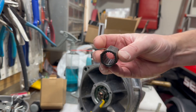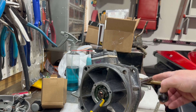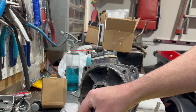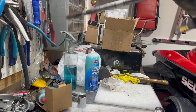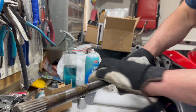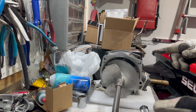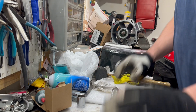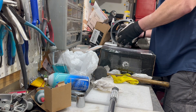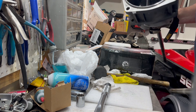At the beginning I said I was using an impact because I didn't have the right tool yet. This is the spline nut that goes over the ends of the splines on the drive shaft. When I tighten this nut, I'm going to hold back using this tool. We're going to torque this to 53 foot-pounds — that's in the manual. I'll use my vice since it's a little awkward otherwise. There's drive one done. Now I'll move over to drive two; this one's already torqued, so I'll set it to the side.